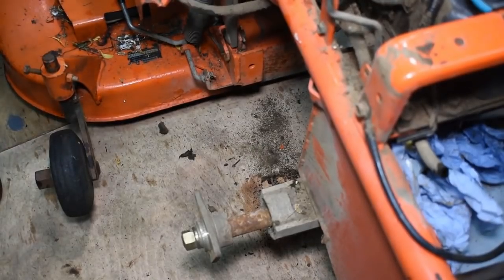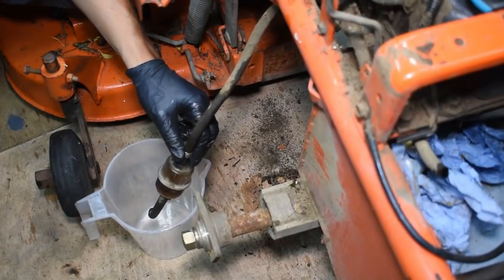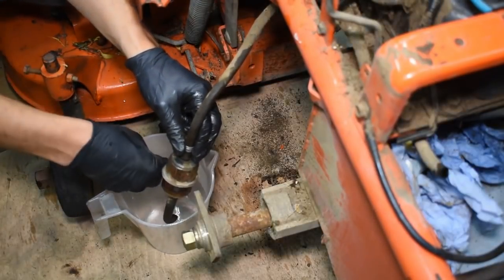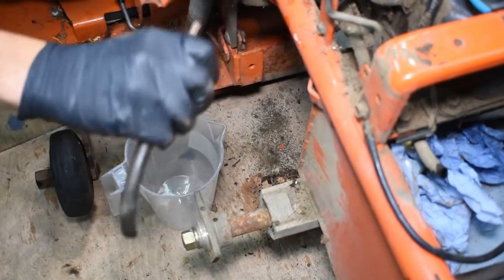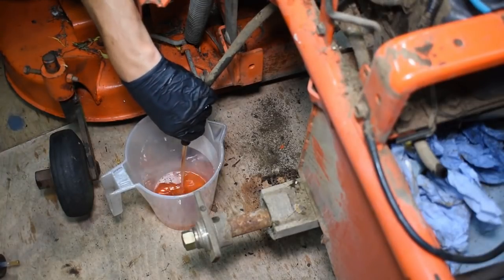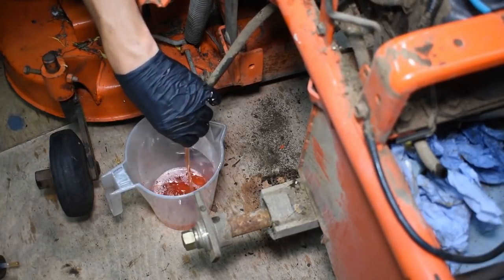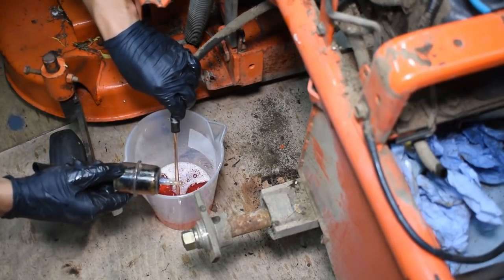I'm estimating there to be about 5 litres of fuel in there, so let's see if it will run out. Okay, so not a drip is even running through the filter. Take the filter off, and it's flowing well. That filter is totally blocked. No wonder the engine was struggling to run. Under load it was just bogging right down and throwing out black smoke.